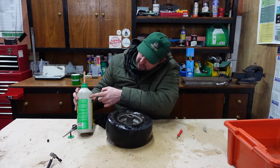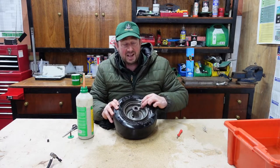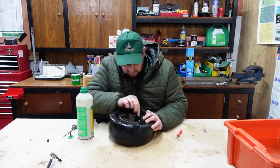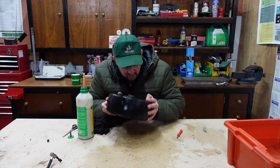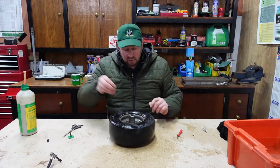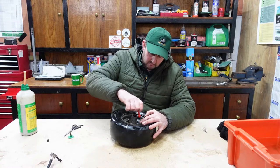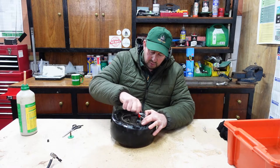We've gone from the top mark at 1200 down 200ml so there's 200ml in that tyre. There's a little bit of residue around the valve — we don't want that on the valve stem or the dust cap — so we'll clean that off. You can just blow down the centre and that'll push the stuff down. If you can't get enough pressure, use the old valve stem, push it in, screw it down and it'll clear out all the residue.